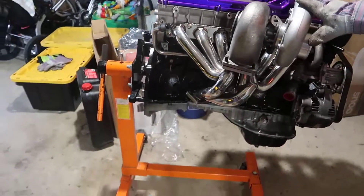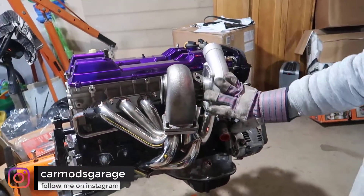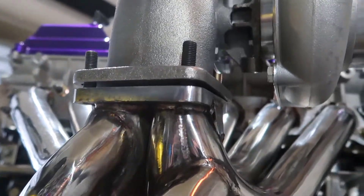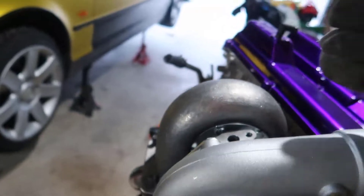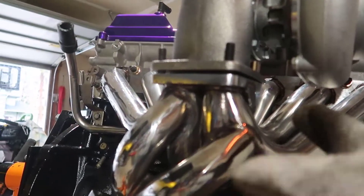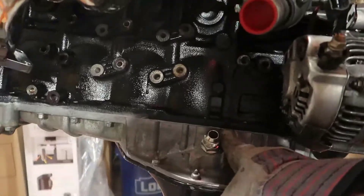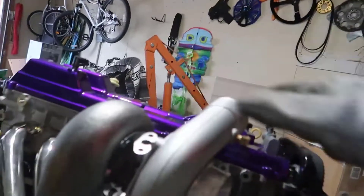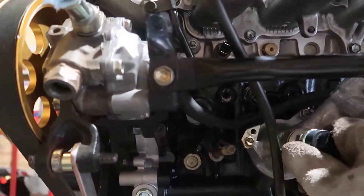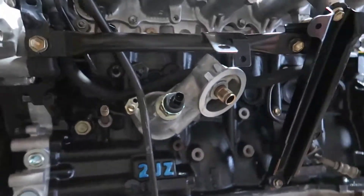We're going to put this on my bench and remove those bolts in here, and rotate this all the way down. That way the oil return — I might need to rotate this too because it's kind of pointing that way, and the oil return is going that way. I want the oil return as far as it can from the exhaust because I already had problems on my Eclipse. The oil feed is always coming from the other side — so this is the oil pressure port. I might be able to remove this and feed from here; I'll have a look and see if there's any other spot.